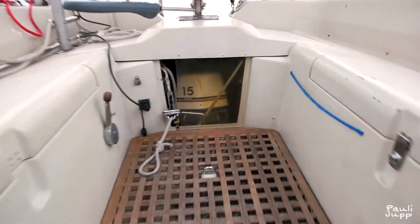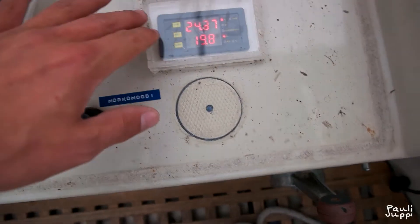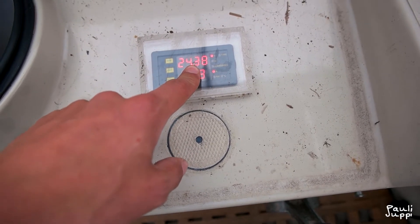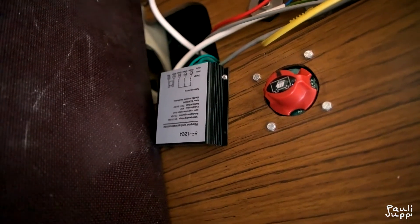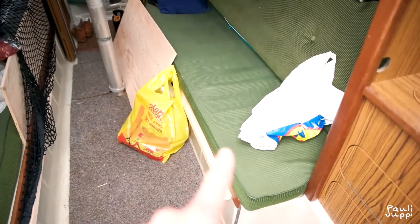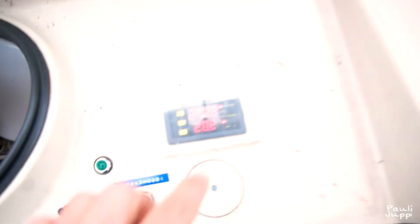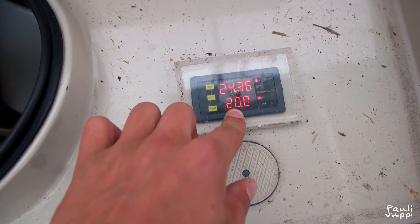The main thing is of course the motor. I have an electric motor over here that I built myself. Here is the control board for the motor. Here I can see the voltage for the batteries I'm using. I have a switch down here — the red one — that I can use to choose which batteries I'm using. It's also the main switch. The four batteries are number one, and the two big ones under here are batteries number two. Right now I'm using number one — those four. This is the voltage for them, and these are the amps I'm now drawing from the batteries.